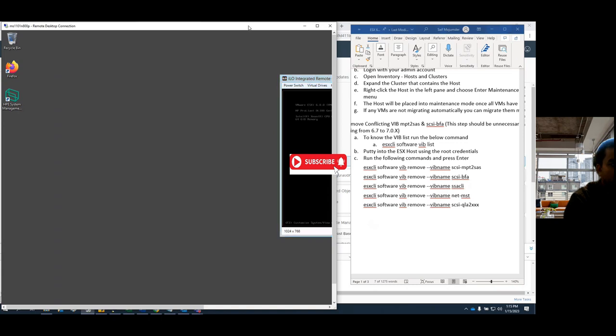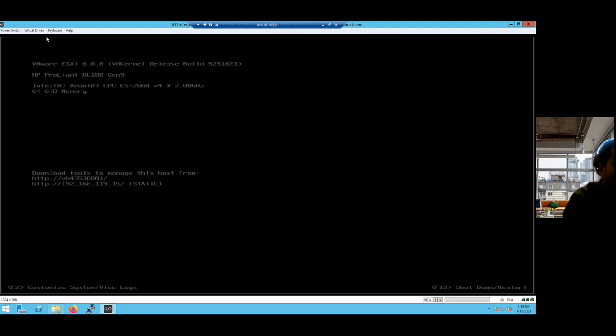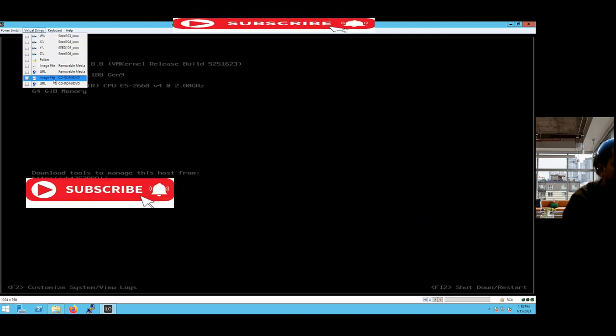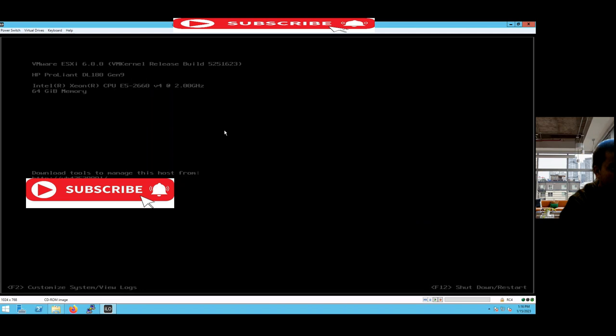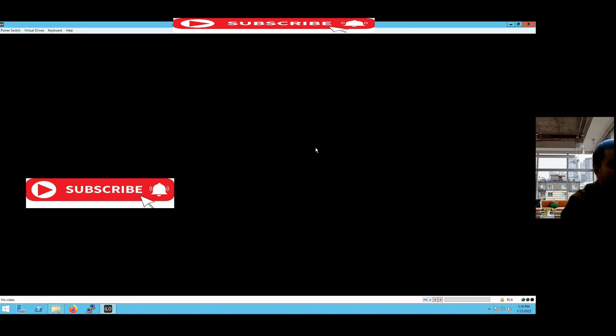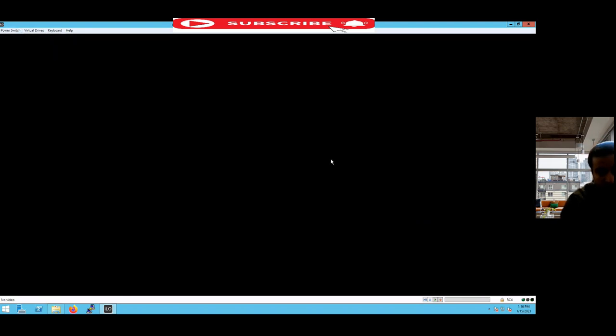Now I can come back here, double click on it, and then drives, image, and which operating system, because this is Gen 8, I cannot go 6.7, I have to go 6.5. So ISO file, ESXi customized, HP customized ESXi 6.5. So I attach it as a virtual CD-ROM. Now, cold boot. That's it. Now it's going to run automatically. You don't need to do anything.